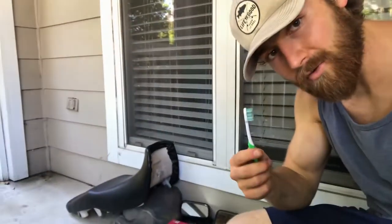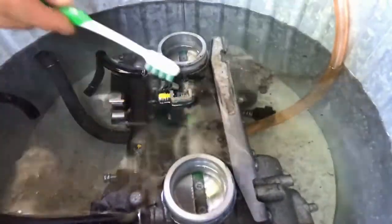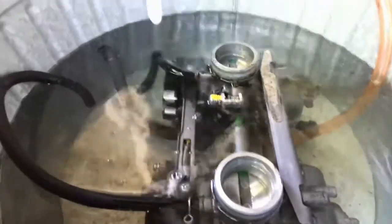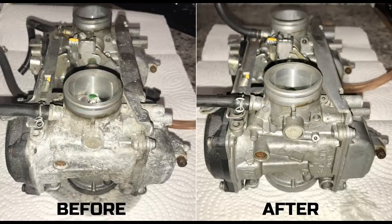This has been soaking for about three or four hours now. After soaking for a while, I just take a toothbrush and scrub a little bit of the carb. Look at that — it's like brand new now. We're going to scrub the whole carb and here's the after: the surface is clean of oxide, no rust, smooth and shiny. Here's a side-by-side at the exact same angle, same flash, no filters, so you can really see the difference. It really did a good job.